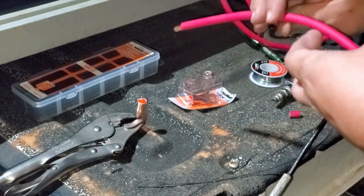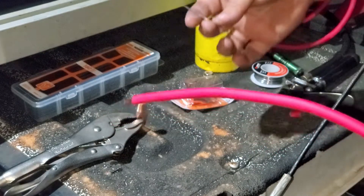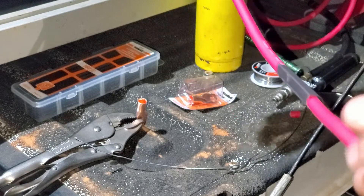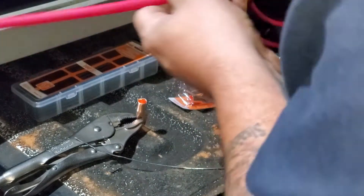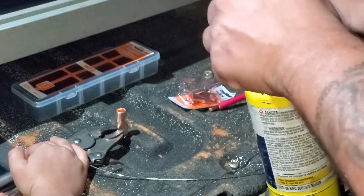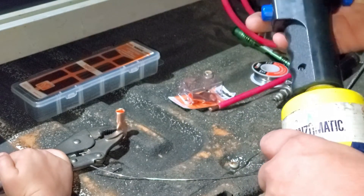What we're going to do is apply some heat with MAP gas, get the lug warm, then fill it with solder. Once we get it full, we're going to stick the wire down in there, let it cool, and that gives us the other end of our wire. Then slide the heat shrink over and we're good to go. Alright buddy, hold that — there we go. Good heat, keep our hands far away from it. Stay safe, don't get burned.